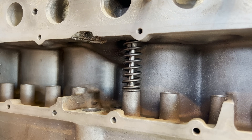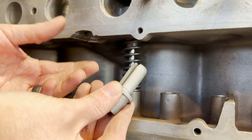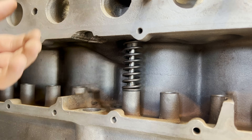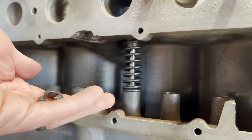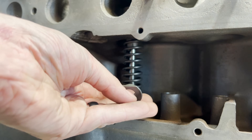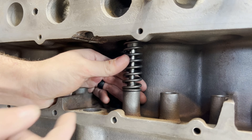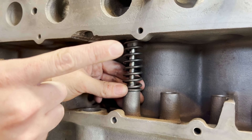That spring is holding the valve guide in place in the block. That gives an ease of assembly and ease of serviceability — when your valve guide wears out, it's just a slip fit in the block, so you can drop these two pieces out, put a new valve guide in, and get moving down the road. The retainer is a little different as well — you actually need a special tool to compress the valve so you can get the retainer put in place.